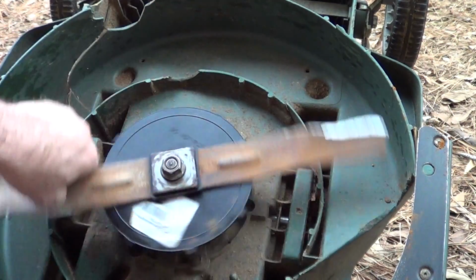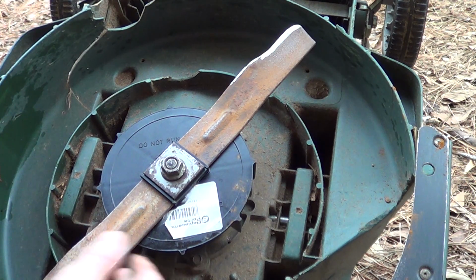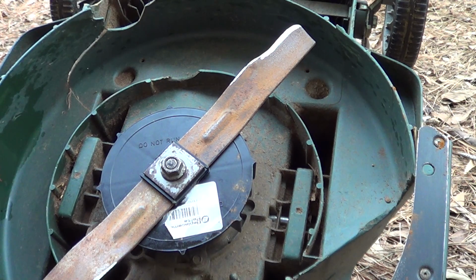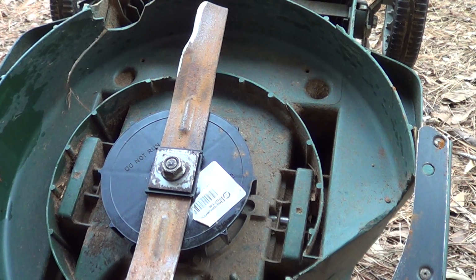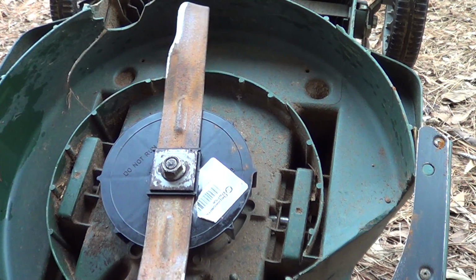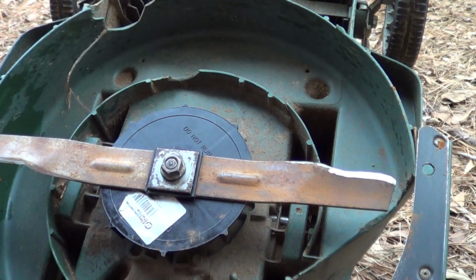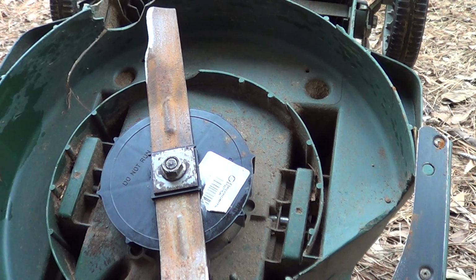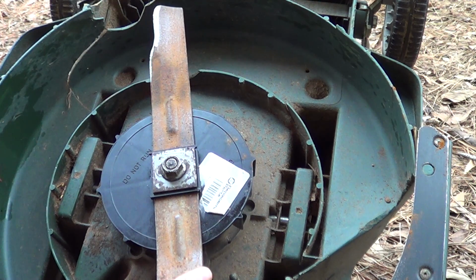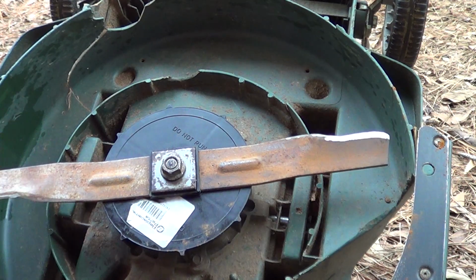The way these are cooled is that this goes around pulling airflow. So if you don't have enough voltage, not only does the torque drop on the motor, you lose airflow. And then when you do that, you tend to burn the motor up. So most of the time people have problems with these mowers is because they use too wimpy of a cord. You can spend as much as 3 cords as the price of the mower. I've actually cut 400 feet away and put a variac and pumped the voltage up so it's about 135 volts, which means at full load it's around 120 at the motor.